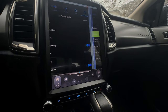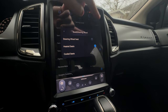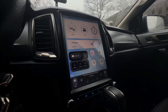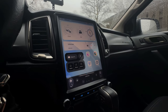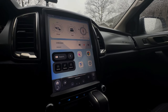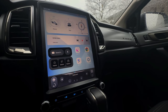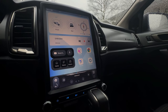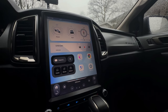Also while we're here on the system, go to Seat and Steering Wheel — if you have steering wheel heat you're going to want to enable that. I just have heated seats so I have that enabled and that's what makes the system work. Overall, this radio is a very nice upgrade if you're someone who just wants a better system. It increases the functionality of your vehicle and overall makes it a nicer interior with a nicer infotainment system. If you're someone like me who plans on doing a lot of road trips, hook up your internet — your 4G if you have a SIM card, or Wi-Fi or hotspot — you can put up YouTube, Spotify, and watch actual videos when you're out and about. If you are the one driving, you cannot watch the video as it's playing, so keep that in mind — you have to be safe and pay attention to the road.